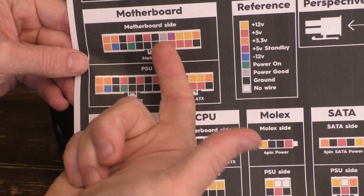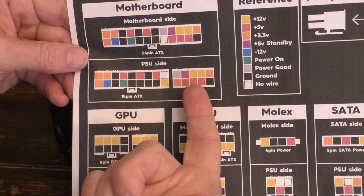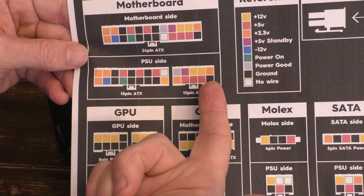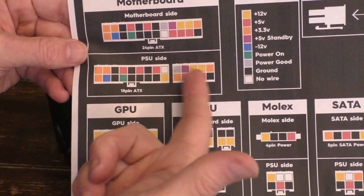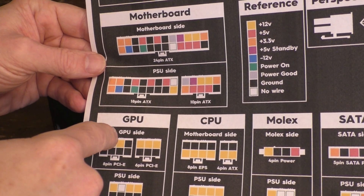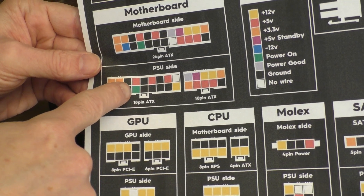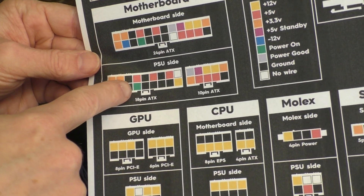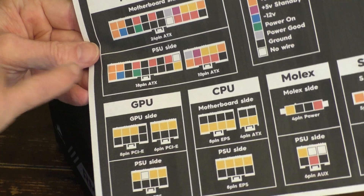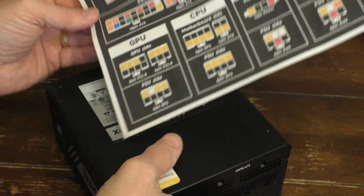So I didn't know the pin-out. Here's the motherboard side — the 24-pin — and here's the power supply side, which is the 18-plus-10 plugs, so 28 plugs altogether. And you can see right here — the green little pin-out. So that should be the power-on pin. And again, the black ones are the grounding, so you could select any of these grounds.